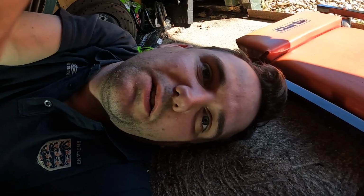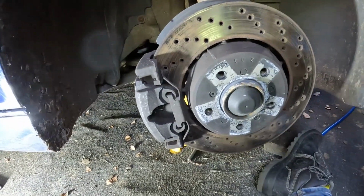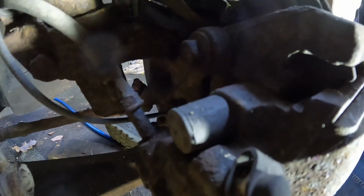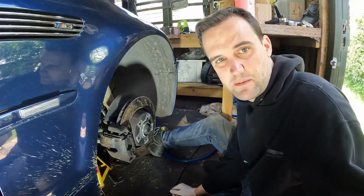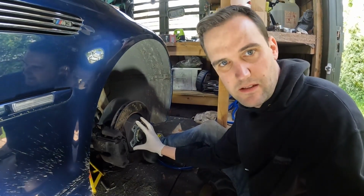Moving back to the brakes. So we've got exactly the same situation on the front discs and pads here. We've got the same kind of spring, the same covers which will uncover the 7mm Allen key bolt, and then the same bolts for the caliper carrier. What we don't have on the front, which makes things a bit easier, is the drums. So under here is just a hub.